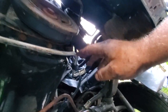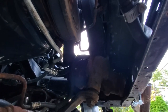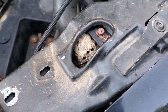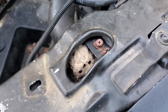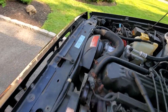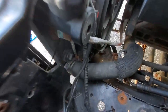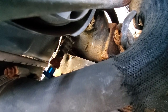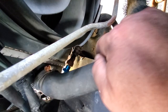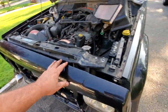This is the high pressure line and it comes right into the radiator right underneath the lower radiator hose - that's going to be a beast to get to. Oh my goodness - mud wasps in the XJ, unbelievable. So after removing my air box and my battery, I lifted off the header panel support bracket - the radiator support bracket - and then I was able to wiggle in underneath the lower radiator hose, got my little decoupler on there, and finally popped this bad boy out. That's how tight it is - the header panel had to be pulled off.